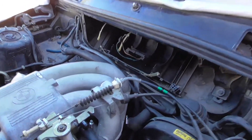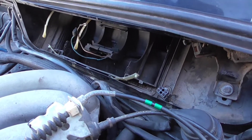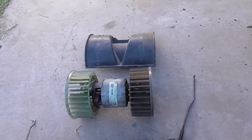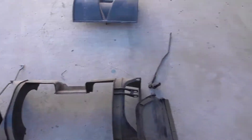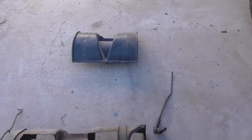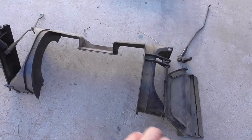In order to get to the wiper motor, you look up the procedure and have to remove the blower motor and the plastic around it. It looks difficult but it's not that difficult if you use the correct procedure. You get to the point where you take out the blower motor, the resistor, and obviously the cover — moving those plastic pieces aside without breaking them.